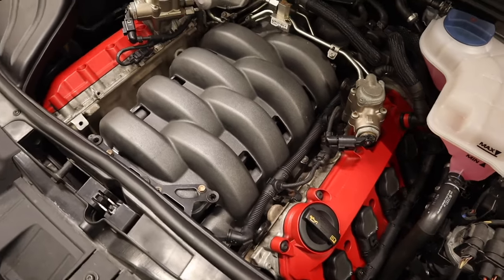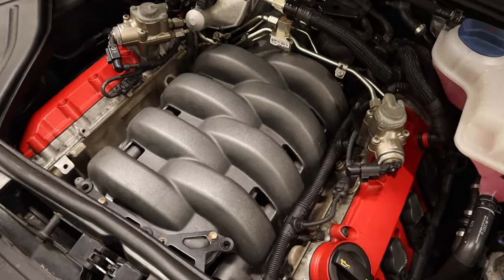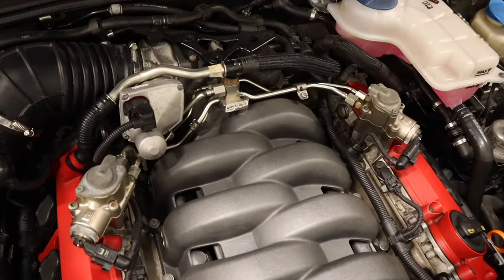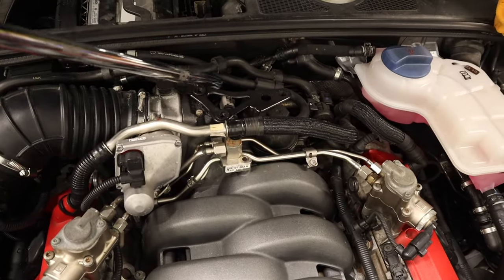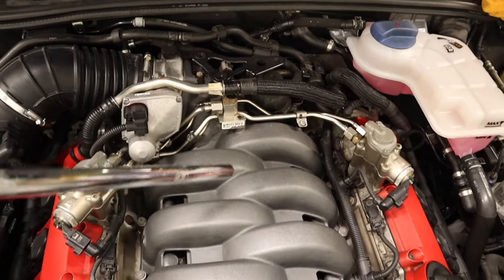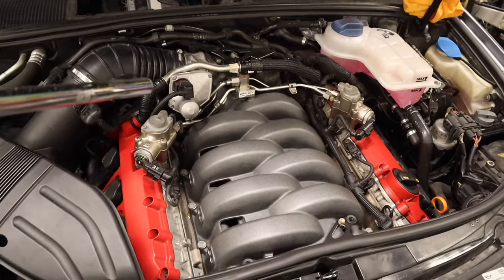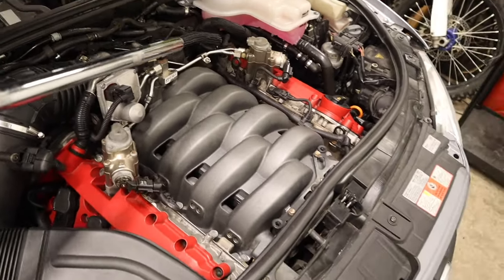The main thing, like I said, was the flap removal — definitely do it on this. It's different than the other cars; this is a completely different manifold than a B6 or B7 S4. The PCV heater hose — that coolant line thing — is one of the biggest gotchas on this. It happened to me the first time until I figured it out, and there was no mention of that, so I wanted to mention it. Some of the fuel system components I remove a bit more of.